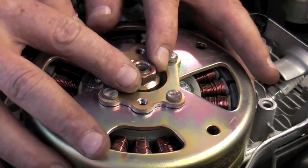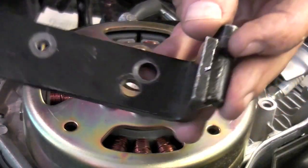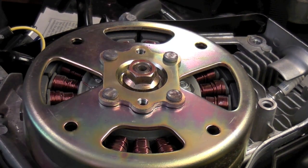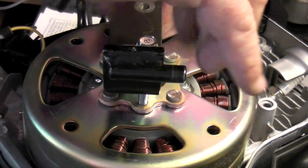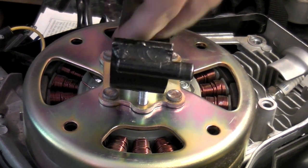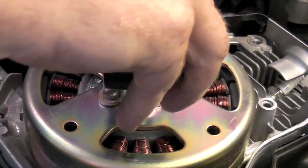You need to be very careful because the bolts from the exhaust are going to be a bit longer, but this will depend on the length of your socket. You'll need to take up clearance using some packing washers in between the bolts from the flywheel and the pulling bar I've made. Be very careful — don't put these in too far, because if you strike that stator you will cause damage and might need a new stator. Check underneath to see how far they're going in, and if they're going in too far, get some washers and put them between the bolt heads and the metal bar you're using to pull.